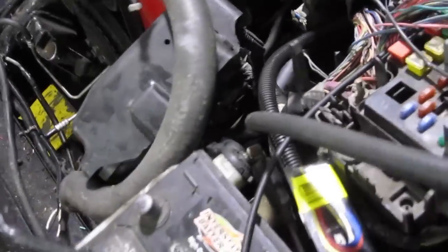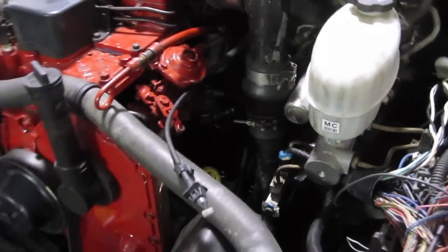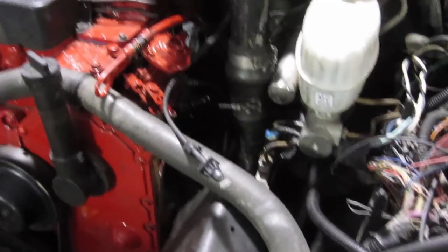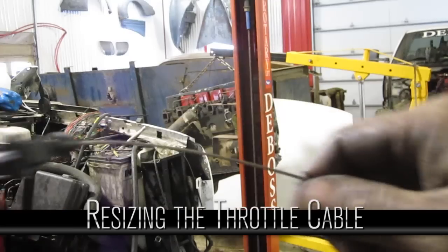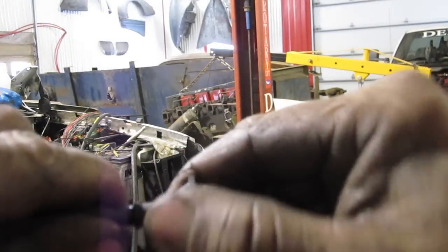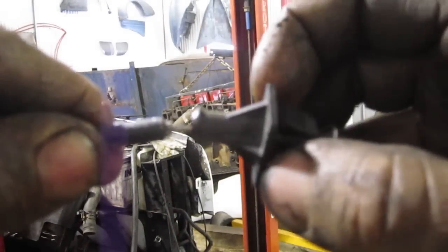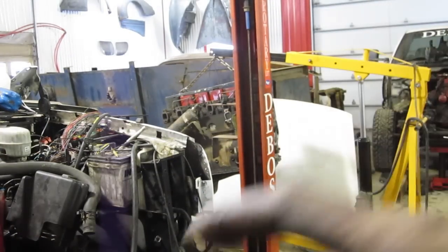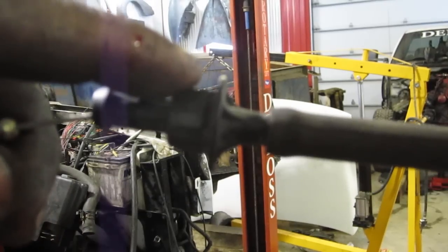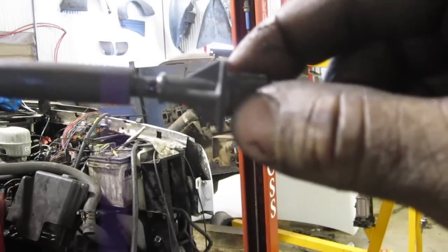We're gonna put the throttle on — this throttle is just out of a 2001 series truck. The spot on the firewall is still there, there's no hole there, but you can drill the hole and the carpet's actually away. Even though it's got the adjustable pedals, we can weld a little linkage on there and the throttle will work the same and the adjustable pedals will still work. For the throttle cables, you can see how long this cable was before I cut the sheathing — you can pry this little end off, cut the casing really carefully, then lock-tight it back on at the length you want. Snip your cable, put it on your lever, and you still have the factory spot that goes in the firewall and the nice factory look of the square spot that lines up nicely for the injection pump.